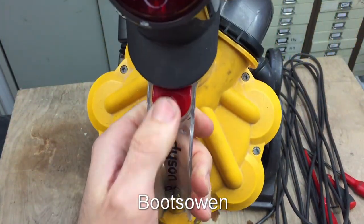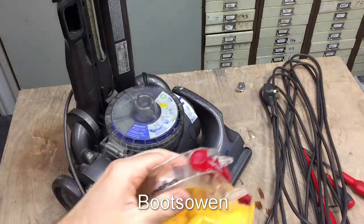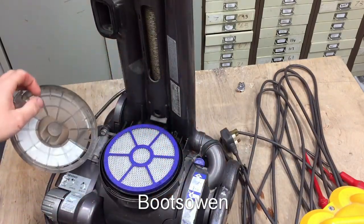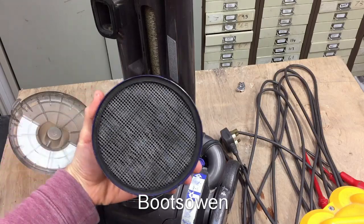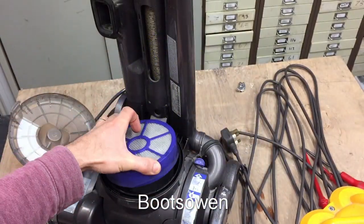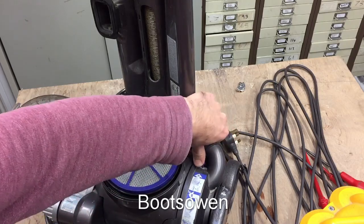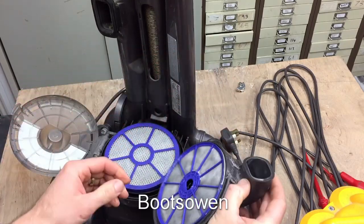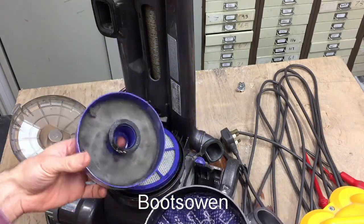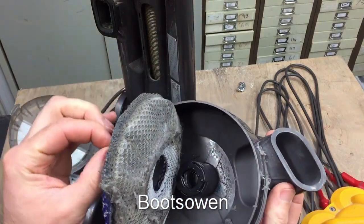Up on top there's this red button. Let's press that — that releases the canister. This one I think has been sitting out in the rain. There's a filter in here; let's have a check of that first. It actually looks pretty clean on top, but pretty black on the outside. That black dust really does need a clean. We can clean it, but it might just be better to buy a new one. And there's another filter in here and this one's soaking wet — always a good sign. The filter itself has completely come apart and is all wet, so that would be worth replacing if we decide to go ahead with this.